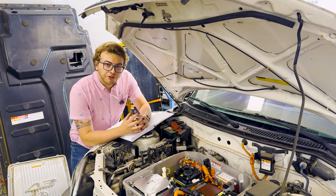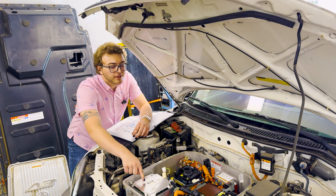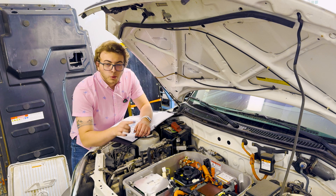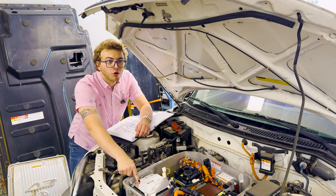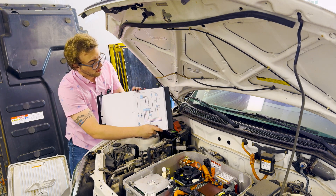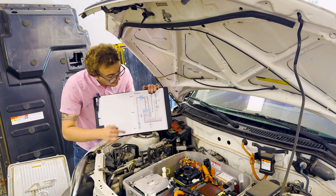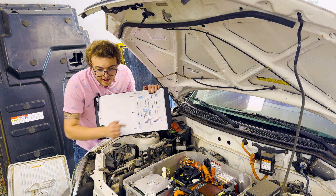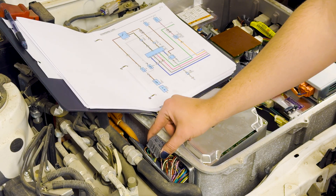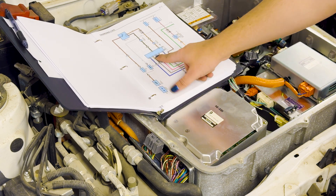The question is how do we actually override these contactors? It's not as hard as you might think because we have the EV control module right here under the hood, which is the module that controls when the contactors are opened or closed. That means there has to be a signal coming out of this controller that enables and disables them. I have the wire diagram for just that — this is the system for enabling charging, and we can see these are our three contactor enable lines. I know exactly where these are. After much effort, I finally got the connector out. From here I can see I need pins 26, 16, and 34 — a violet, a gray, and a pink wire.